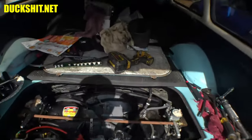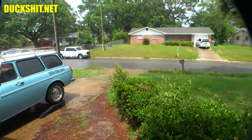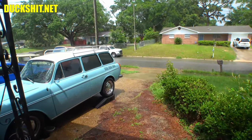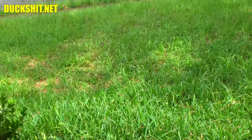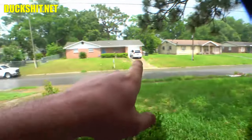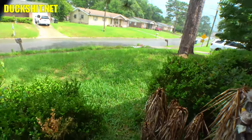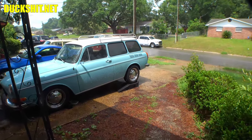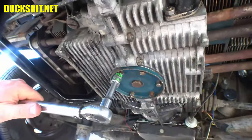It's about to rain but it's the sun that's killing me — pouring rain in the sun, not something I've ever captured here before but it happens on the regular. Today was one of those days where I knew it was going to rain but I had to stay out of the sun because I was going to burn. The rain has been so intense — look what it did to my yard. I've got to cut that thing. Okay well, that slowed me down on the project a little bit. I did not torque the oil strainer plate yet — these are only torqued to somewhere between 5 and 8 foot-pounds. These are very mission critical that you do not over-torque them because they screw into magnesium.